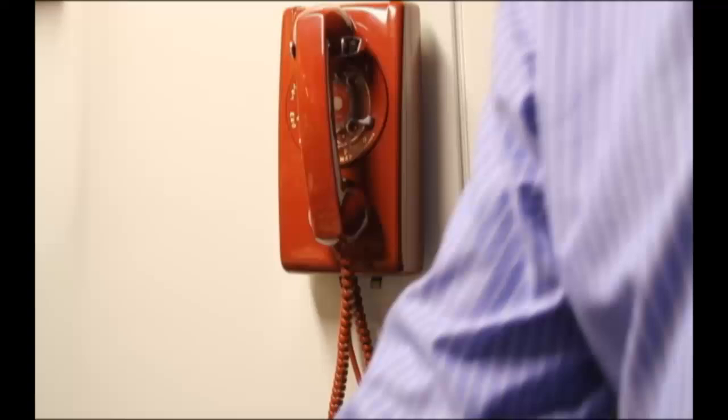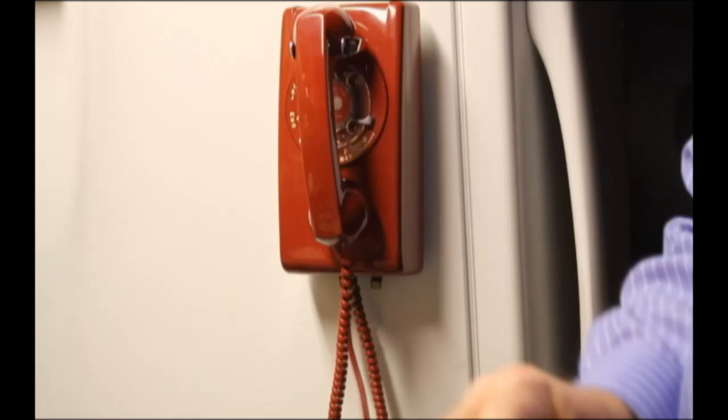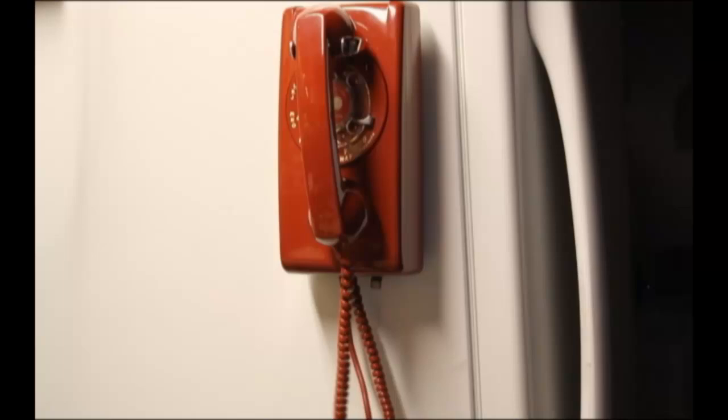The phone has been adapted to remove the four-prong adapter, because most people have modular jacks now. I'm giving you a pigtail so that you can plug this in and then plug it into your jack. Or if the phone is 20 feet away, you can use a longer modular cord, mount it on the wall, run this, and you'll have a longer cord. You can run it completely across the house if you wanted to.